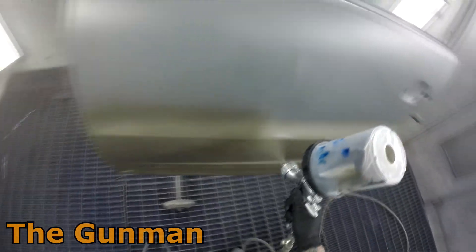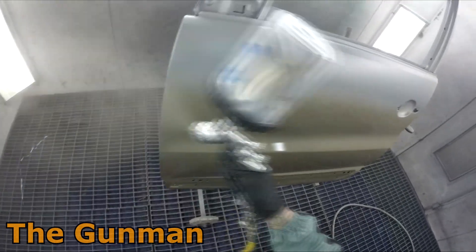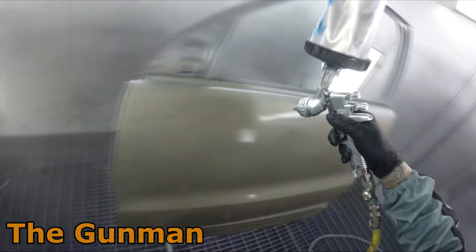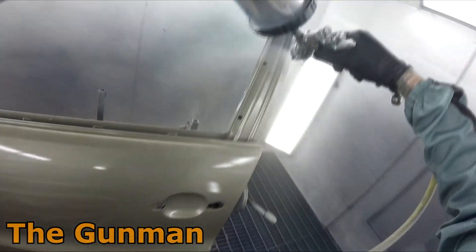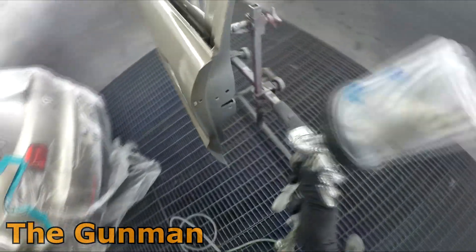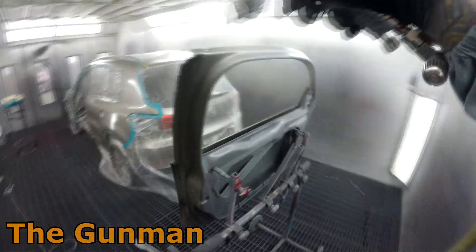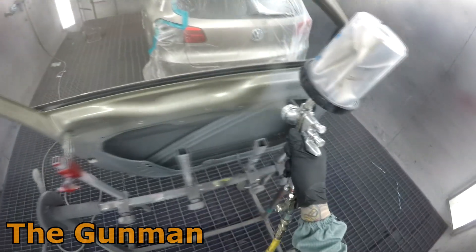Application as far as the base coat goes - I'm already getting the hang of it within a week, and I will probably not want to go back to solvent at all. Drying times do take a little bit longer, but once I've got the base coat on I'll just set the booth up to about 40 degrees - supposedly you don't want to go too high or else you can start causing issues. You've got the option of getting these air blowers - we've just got handheld ones. You can blow some air over it if you're in a hurry, otherwise I'll just go and get my next job set up, mix my clear, clean the guns - there's really no downtime.